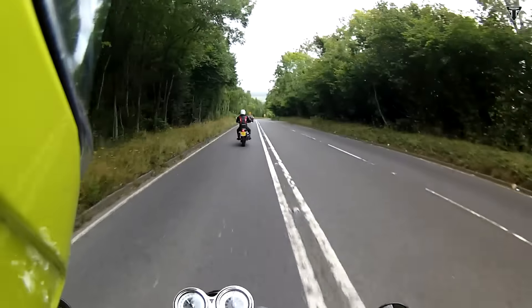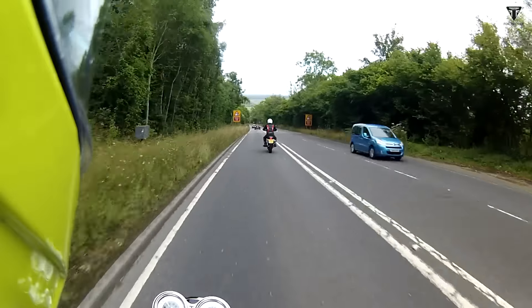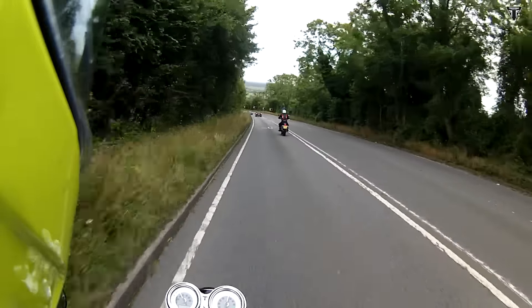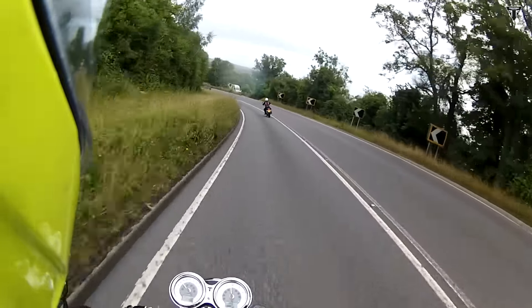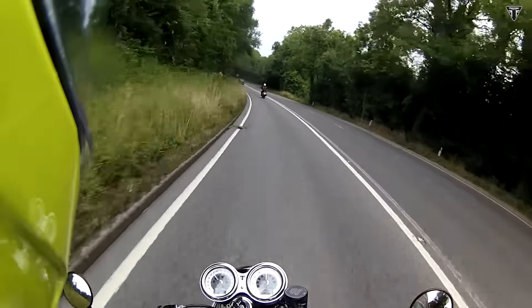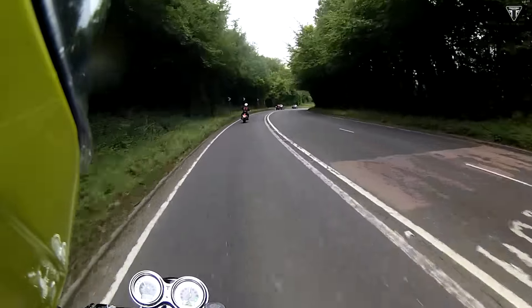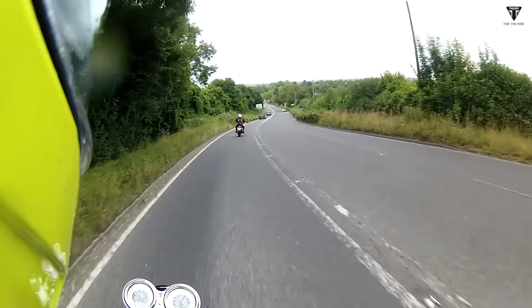But it's all been drama today, all drama. I thought I'd pop down here to say hello. What happened was, on the A3, whilst I was going rather fast in lane 3 towards Guildford, the spring on the sidestand snapped. So the sidestand swung down. It didn't hit the floor or anything - that wasn't an issue. What was the issue was the engine cutout switch connected to the sidestand when the bike goes in gear. Cut out. So I pulled over. The AA turned up and gave me some wire.